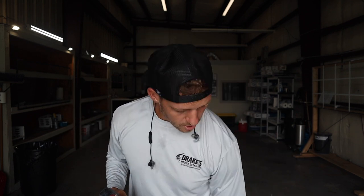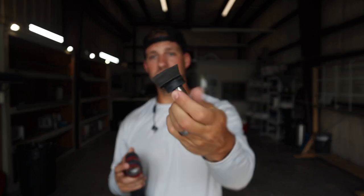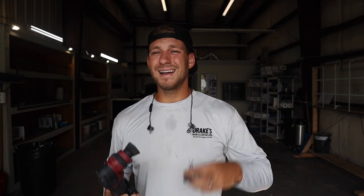When it comes to battery life, one thing I've noticed is that when you use a three-inch pad with the three-inch backing plate, the battery dies a lot faster than when you're using the one-inch backing plate with a one-inch pad. I'm guessing that has something to do with torque — it takes more power to push the three-inch backing plate. I'm going to say this is a one-inch pad machine, not necessarily a good three-inch pad machine.